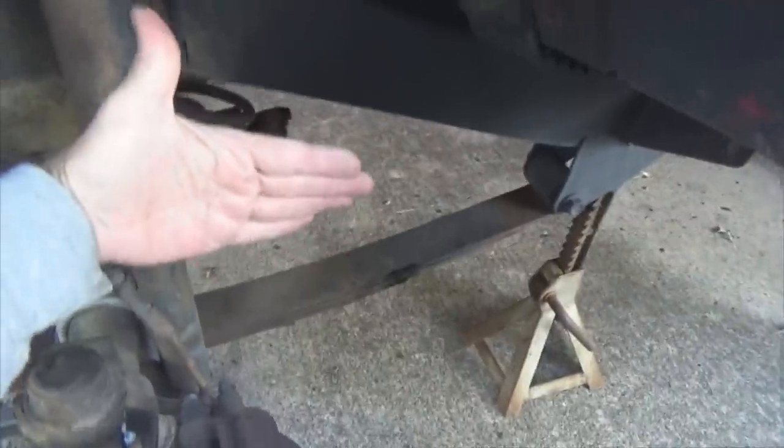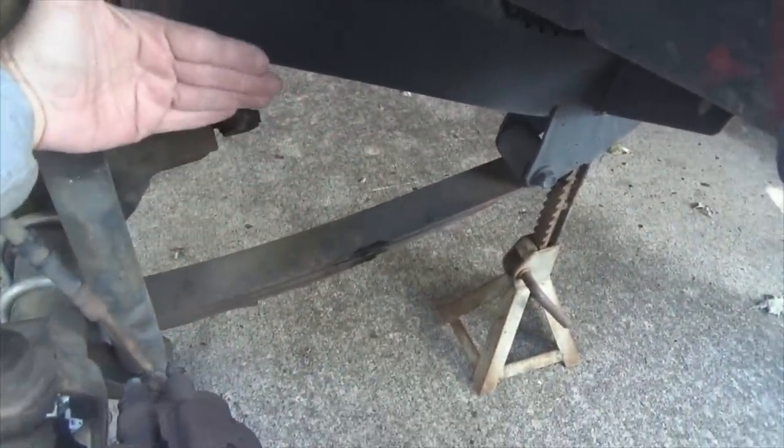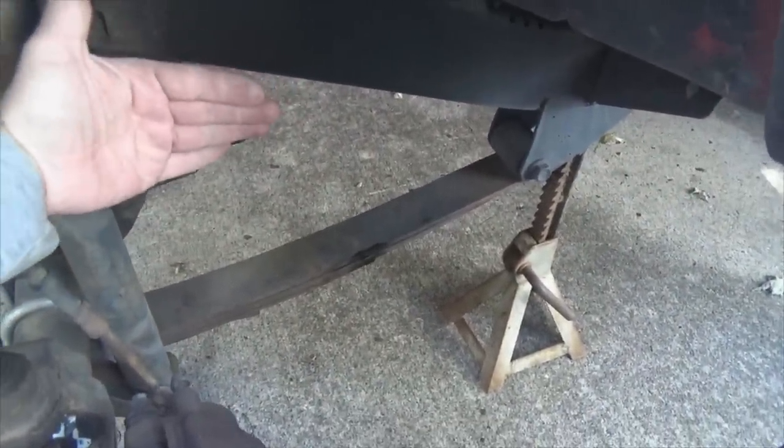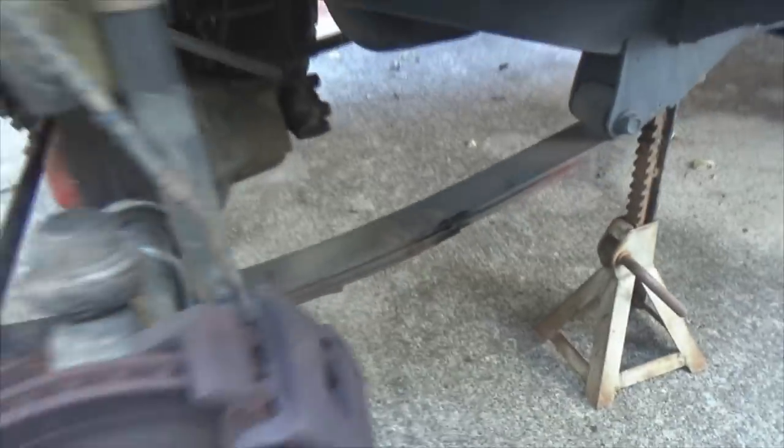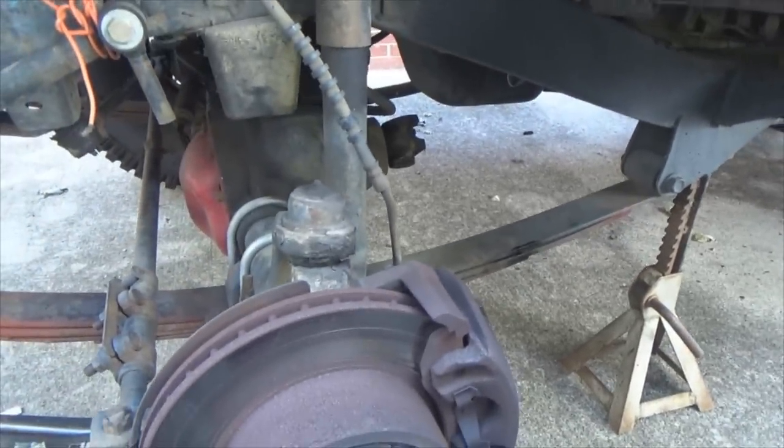But what it also does when it comes out this way, that angle as it comes in gets closer to all your suspension components. Not only that, these are 12.50 wide. Whenever you go to a wider tire, the inside of your bead could be here, but once you go to a wider tire, it pushes that bead on the inside, or actually the tire tread to the inside, which again complicates the situation of making contact with your suspension components.